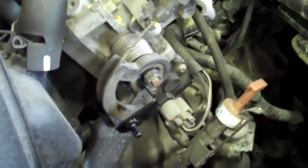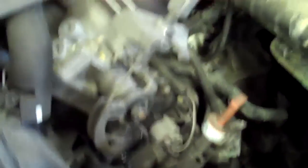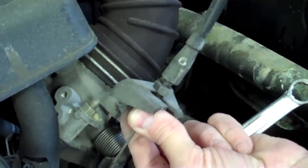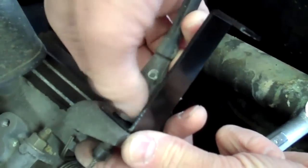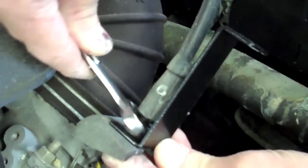That's our throttle bracket, and now we want to put on our anchor bracket. It's going to come up and we're going to loosen the 14 millimeter nut that's holding the original equipment throttle cable on. We just back that off a little bit, insert our anchor bracket, and snug that one right up.